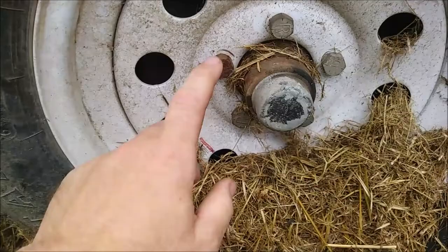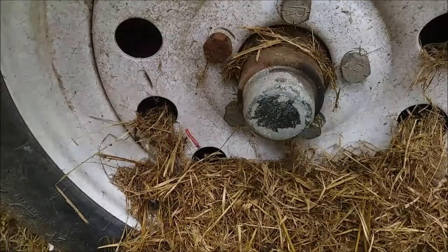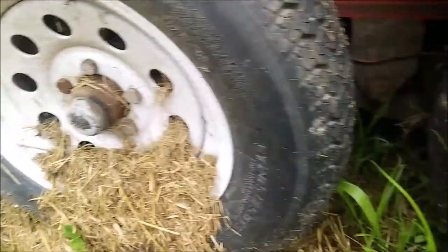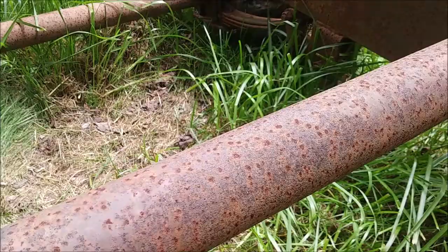If we come out and look here, we've got five lugs — but they're not standard lugs. They're the boat style that have a lug but they're not backed on the backside; they screw in and they have reverse thread on the front one. I already went ahead and changed the brake plate on the backside to one that has the studs on instead of the screw-in bolts.